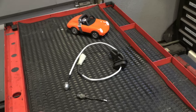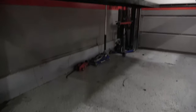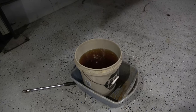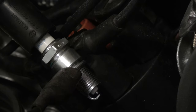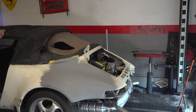I'm going to upgrade the cylinder head temp sensor from a one-wire to a two-wire — it's supposed to be more reliable. I got tired of messing around with this and decided to dump the fuel like I did on the last one. Look how dark that is — been in there likely quite a while. It looks like coffee, just not so tasty. Looks like it's got spark now, so let's give it a try.